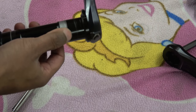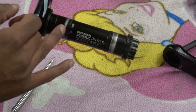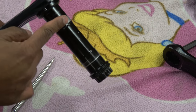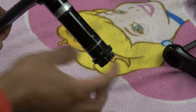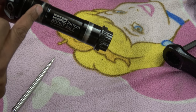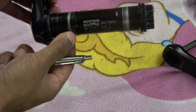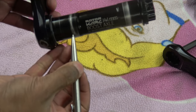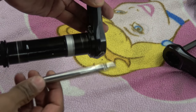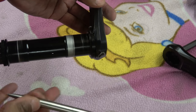The misalignment on there is horrendous, absolutely ridiculous. That's the bearing track — you can see the load mark. Here's where this axle hasn't been loaded that much, and then 180 degrees over it's been loaded excessively, and it's opposite on the other side. The other telltale giveaway that this is properly fucked is the track or tram line — it's about 7 mil wide in one spot but has gone off around the other side. That essentially guarantees the bottom bracket on the bike is misaligned. So that's what we've got, and now we need to know how to fix it.